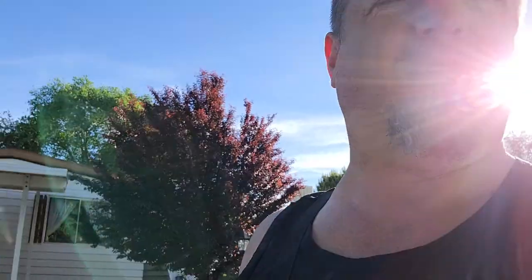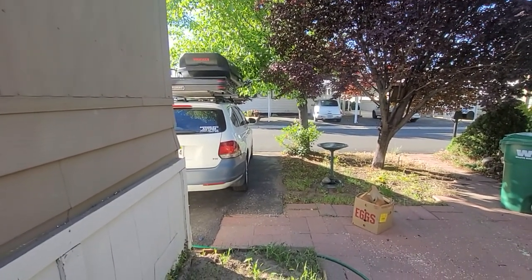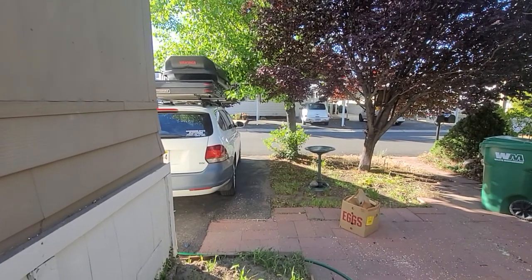So I did a quick update, and I gotta go to work, and when I get a chance to edit this video, I will list the parts and links for anybody else. It's really hard to put this together. Right now we've got 30 millimeter spacers on front and back, and we have the towing springs in the rear and the Tiguan springs in the front, and we have Bilstein HDs in front and back. The Bilsteins are noticeably firmer, so they won't be bouncing around like the Konis.